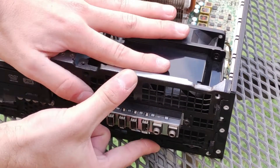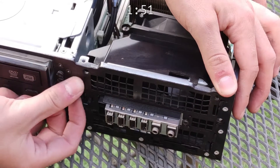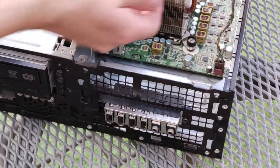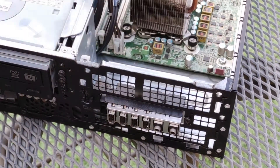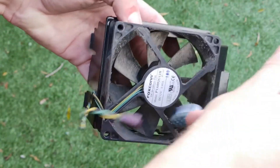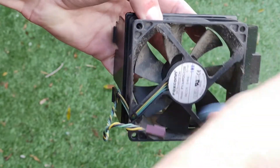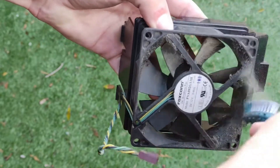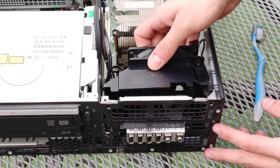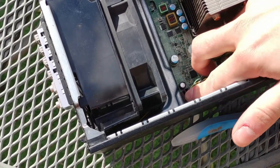If you would like to clean an intake fan, take off the front panel as shown earlier and unclip the fan shroud from the metal panel, remembering to disconnect the fan from the motherboard. The fan assembly can be cleaned easily with an old toothbrush and compressed air. However, if you blow the dust out with compressed air or a pump, keep the fan blades still, as blasting them with air at high speed can damage the bearings. Afterwards, the assembly can be clipped back into place, the connector reattached to the motherboard, and the front panel reattached.